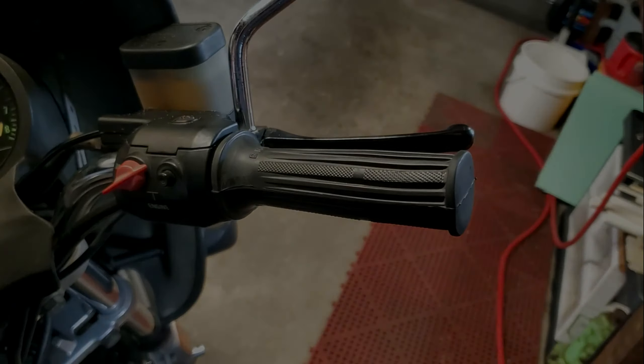In the last video clip I was showing how the throttle tube was returning a lot better, but there was a lot of play in it. I didn't have the timing marks on the gears inside here on the cam lined up. I thought I did — there was a mark, but it's just a mark in the metal, not actually the timing mark. So I didn't have it actually lined up.